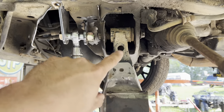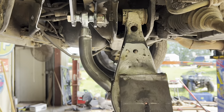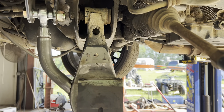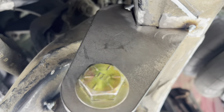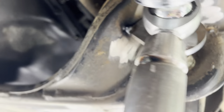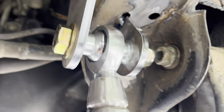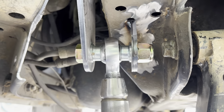All right, let's go see if they fit. We got the tabs tacked up, got everything where it'll pivot freely. Looks beautiful. The bolts aren't tight, but they're in there. You can see the fitment on these tabs — nice even gap right here to lay a weld in on both sides, and I've got clearance right between my bolts now. Worked out pretty good.